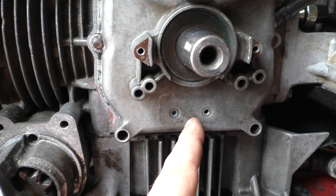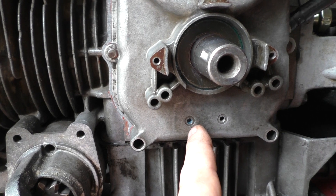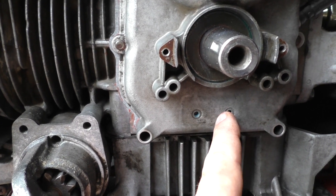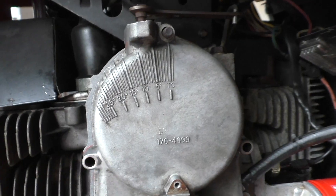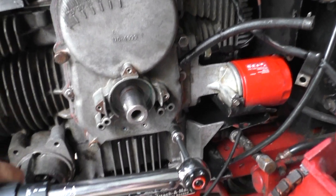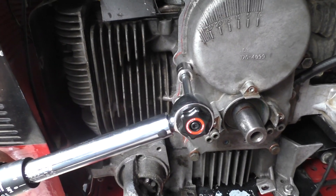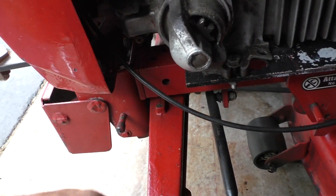We've got our cover on. One thing I wanted to mention is this isolation gasket that goes on here for the crank position sensor. These bolts — I mentioned earlier it may have been leaking from one of these — are solid on the back, so the gasket is really just for isolation of that crank position sensor. No oil can get out because these are not pass-through holes. We're going to get these bolts torqued up to the proper spec — I believe it's 10 foot-pounds, or 120 inch-pounds. This is aluminum, so we want to be careful and not over-tighten.